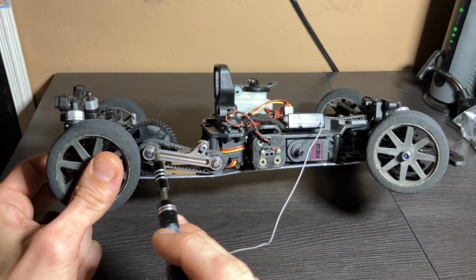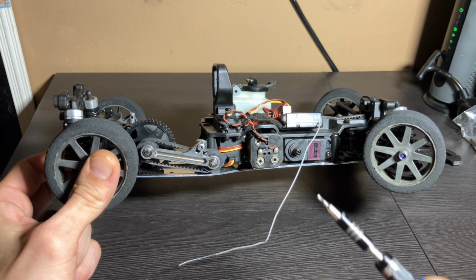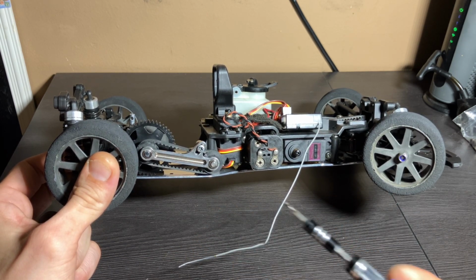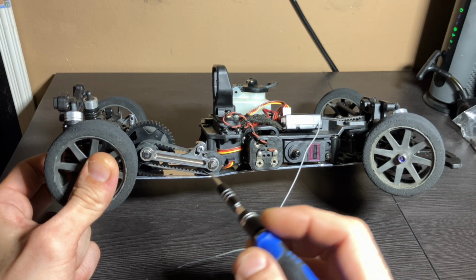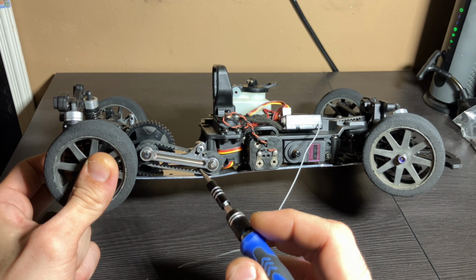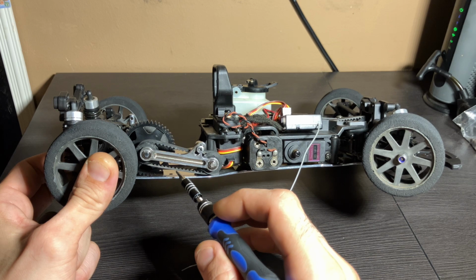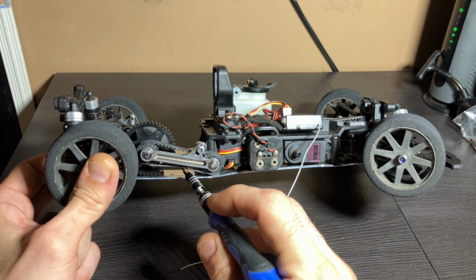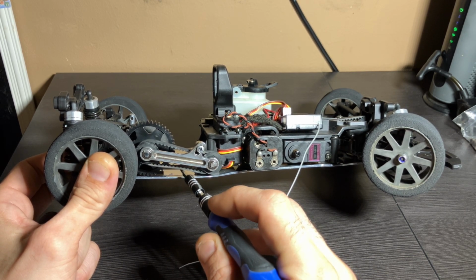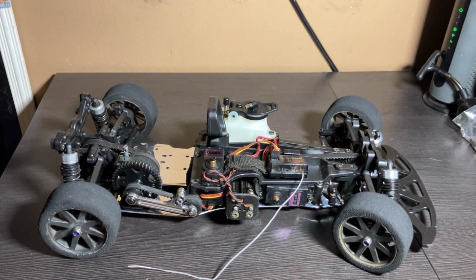This is basically an oval from factory with no tensioner, and it seems like it'll pop off just from riding. Actually, it looks like if you look at it, it'll just come off, but it rides just fine, and I never had an issue with it. I just bought the tensioner because I feel more comfortable, and as you can see, it's pretty loose. It's not even tight at all. So just make sure that you don't over tighten your tensioners as well, because they will cause a bind.